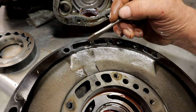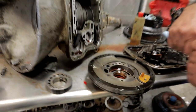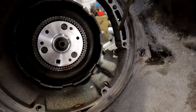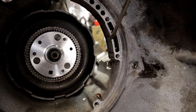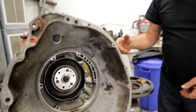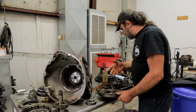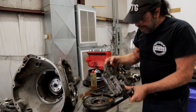That was the issue right there — an air leak on the suction side of the pump. Inside the case, that section is right there, and the missing piece of gasket is exactly here. I laid a straightedge across it and there are no defects or weirdness in this area, so I'm going to chalk it up to a freak gasket failure. We'll put it together with a fresh gasket, fresh clutches, and fresh seals. Everything else looks good in this transmission — all the bushings look good and the pump is beautiful.